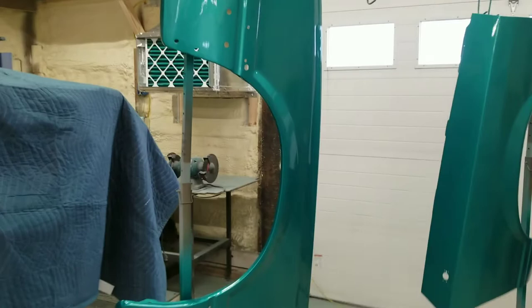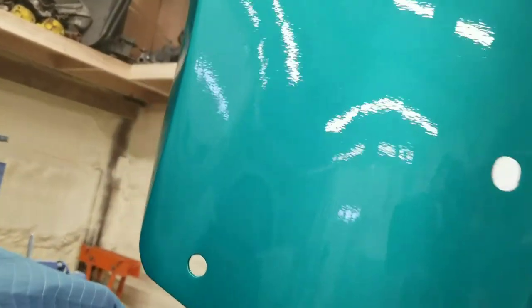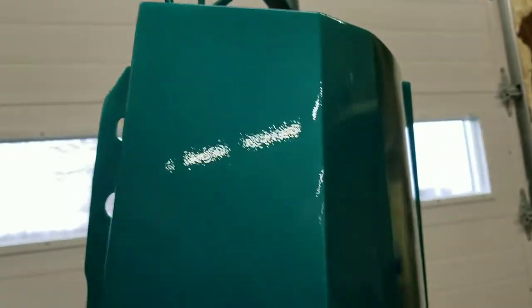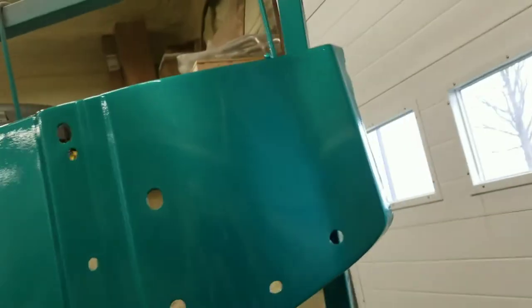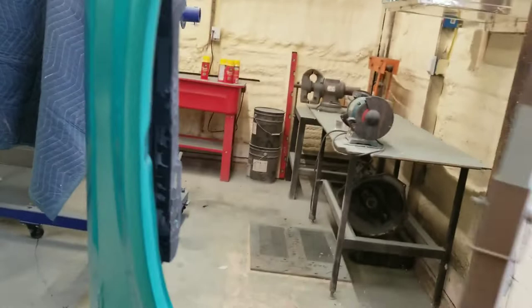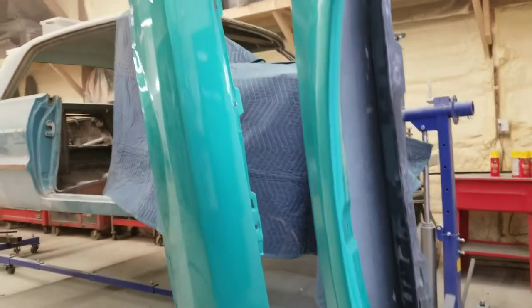All right, coat one of the clear is on — looking slick. I usually put the first coat on a little bit drier than the rest; that seems to do the trick for me. The next coat I'll lay on just a little bit thicker to get rid of all the orange peel and make sure it lays out like a mirror. I usually never lay it on heavy on the first coat because I always seem to get runs. Put the first coat on good and dry, then come in hot with the next one and it usually looks beautiful. We'll be back in a few minutes to throw the second and third coats on.